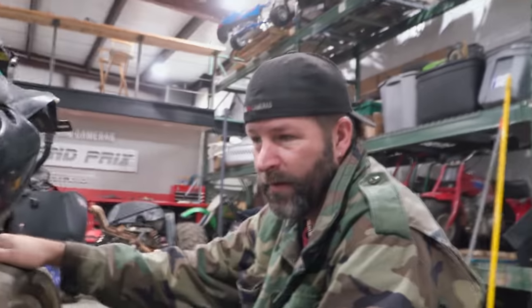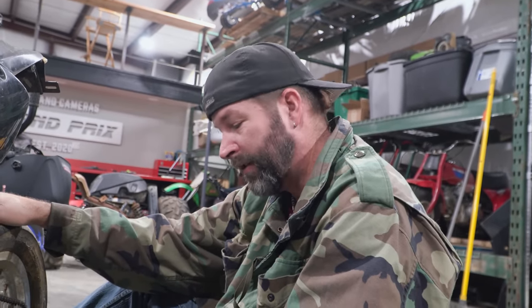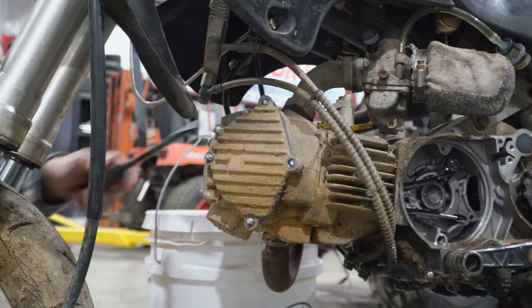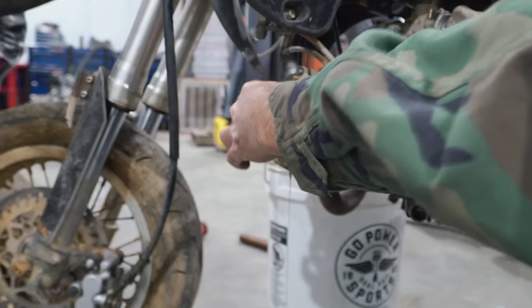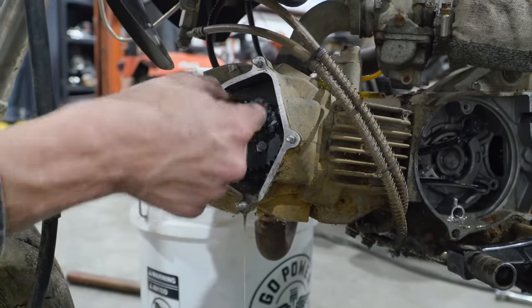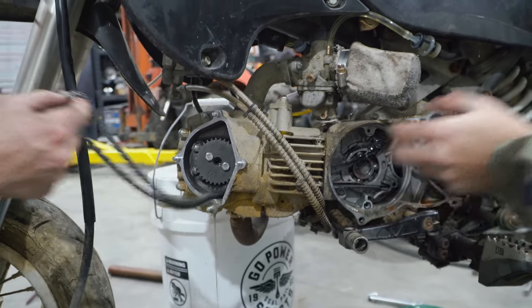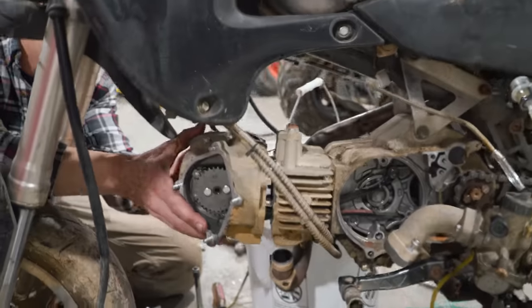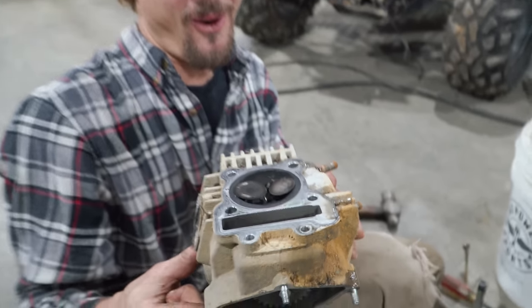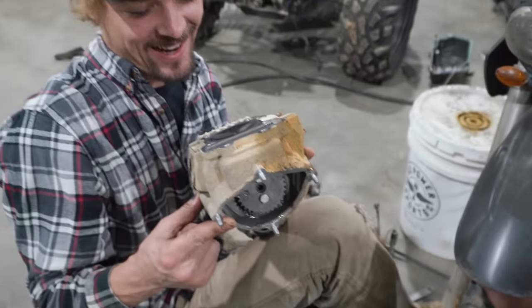Good job, sir. I'm notorious for it. Did the valves hit? Yep, they're bad. Oh my gosh, that is so bad — you can fit my finger through there. Should we do a leak down test? I don't think it's necessary — you can see daylight through it. It's got a hemispherical combustion chamber now. One thing I noticed: that piston is not coming flush with the deck. Do you think we bent the rod? We might have, with it whacking both valves like that.